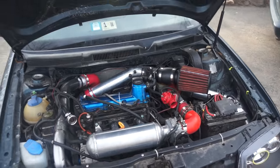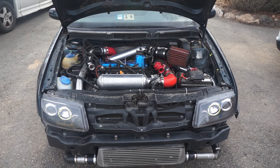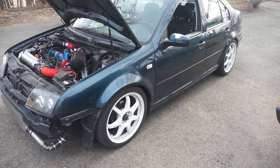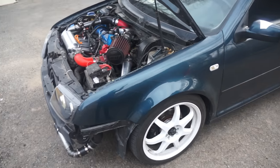Alright guys, so I just got back home. Everything is running good. As you guys heard, it sounds real cool. It backfires a lot — pulls in second gear, let off the throttle and it will backfire. It doesn't feel like it's gonna shred the transmission. It's running about 9 PSI peak. The way the power is with turbo cars — lag, lag, lag — and then it gets into boost around 3,500, pulls to about 5,000. And then I just let off the throttle, backfire or blow off, and then it will shift gears. The one time I didn't let off and let the transmission do its thing, the clutch in the transmission will kick in and kind of hold it there — that's where it's gonna fry some things. So if you have an automatic transmission, I'd just let off, let your foot off the throttle and let it shift on its own. Also, you have no control over what gear it's in, so it runs really lean when you're engine braking — you kind of have to keep your foot on the throttle so it's not maxed out lean until the transmission shifts and then it'll drop the fuel ratio.